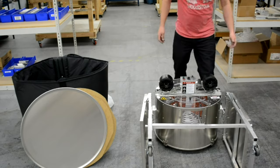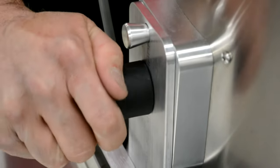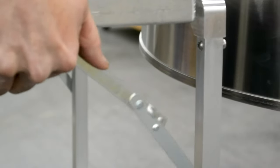Unlock the plunge pin and slide the stabilizer bar down until the plunge pins are engaged with the lower stand. Lock the unit upright, lock the plunge pins, and tighten the drum knobs. Lift up the side tables and lock the four lid stays.